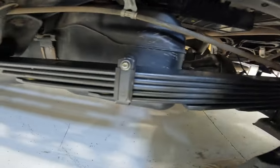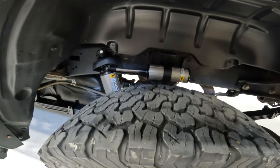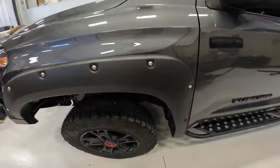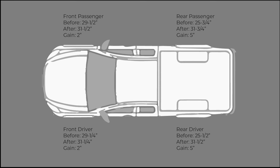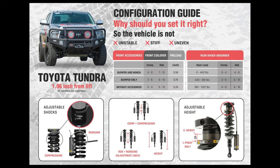The new springs are substantially beefier, which is great. I really love the gray tone on the BP-51 shocks from Old Man Emu — everything matches the truck so well. I ended up getting about two inches of lift in the front and five inches total in the rear, which makes sense because the rear was so squatty. The factory TRD Pro lift comes with two inches in the front and none in the rear. Here's the 16-foot trailer that I pull all the time — you can't even tell it's hooked up, and there are five motorcycles in there right now. Please like and subscribe.